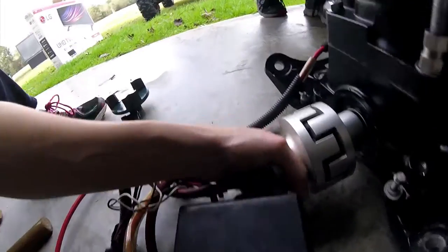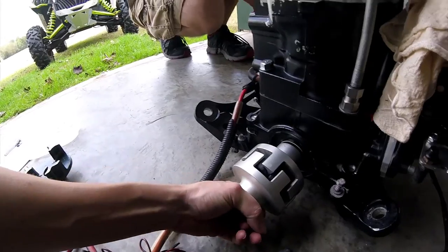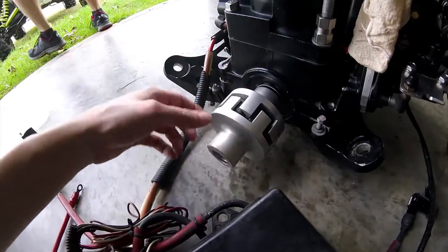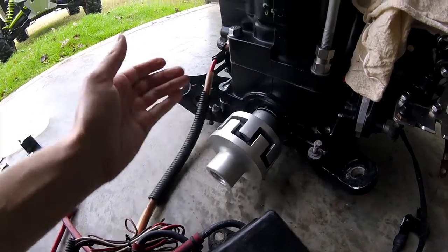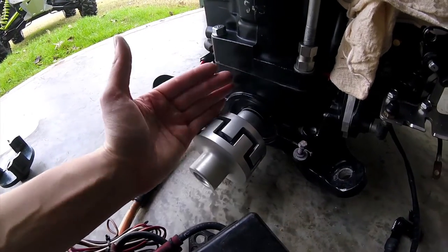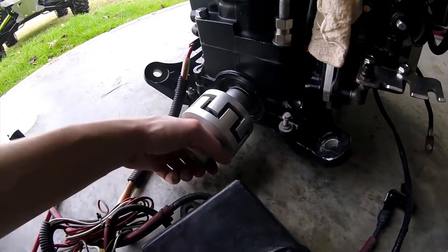Come on. So with the coupler, I'll show it out here since we're about to put it in the hull. If the midshaft one's too high, then you need to shim up the back of the engine to make it even. You'll use a credit card or a plane, anything with a straight edge that's short enough, and go all the way around and make sure that both levels are even. That's how you shim the engine up to meet the midshaft.